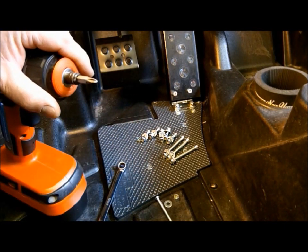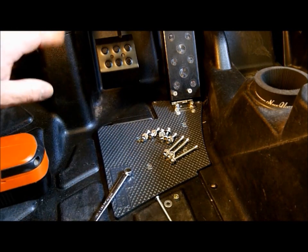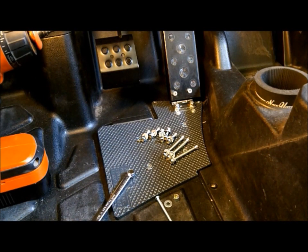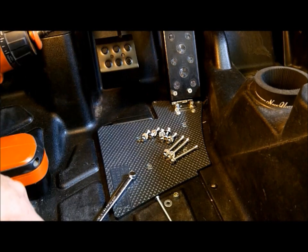You're going to need the screw gun with the Phillips bit and a 3/8 wrench, and probably the help of a friend to either operate the screw gun or the wrench. First you're going to want to drop the skid pan enough to where you can access the bottom side of the floorboard to install the washers and the nuts for the screws.